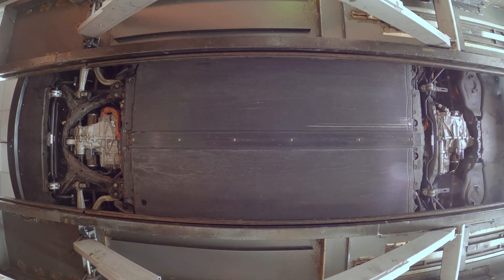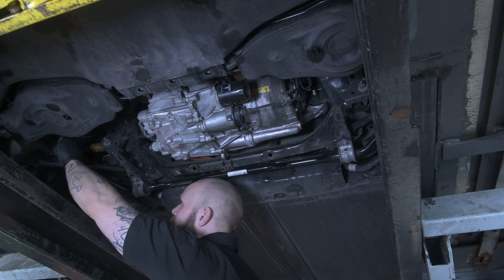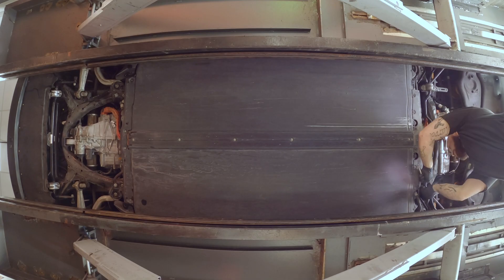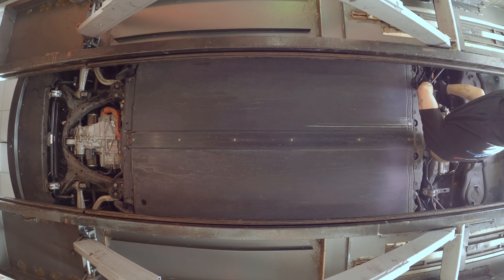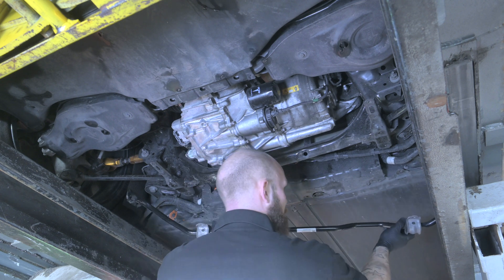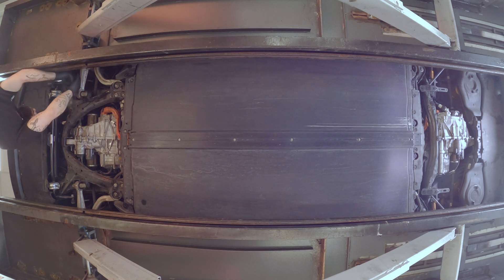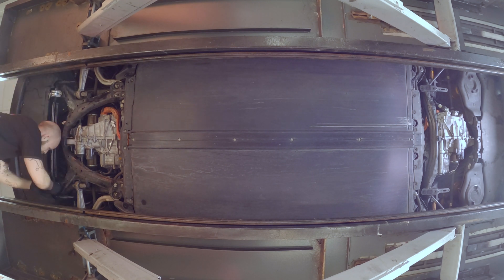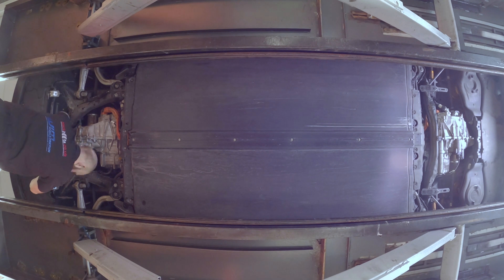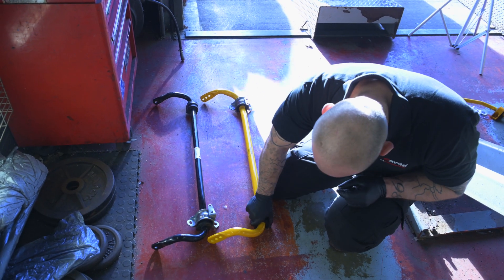While that's going on, I'm just going to talk about something I mentioned earlier — the fact that anti-roll bar upgrades generally don't affect the ride quality too much. When the car is on a level road and not cornering, it's not putting any load into those bars, so it's sitting there exactly as it would with the standard factory anti-roll bars on. That means you're not affecting the comfort of the car — you're only improving the handling when cornering, and that's really getting the best of both worlds. It's a simple product, a couple of metal bars and some fittings, and the labour involved isn't that great either, so it's a really cost-effective handling upgrade.